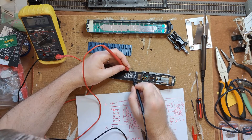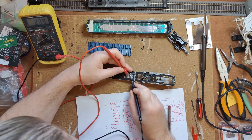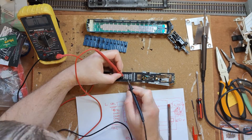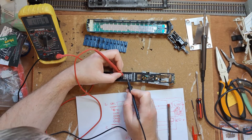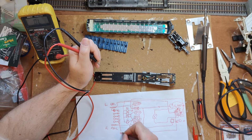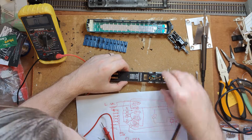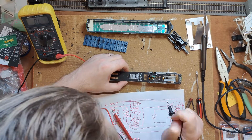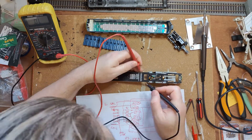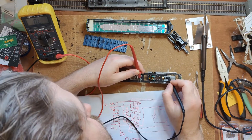The negative side of the interior light is much simpler. This was connected to both rails via diodes D5 and D6, so whichever was low would provide a current sink. This works absolutely fine in DC, but in DCC mode there's an unbalanced power draw through the decoder. Pin 7 is providing the power for the carriage lights, which is sourced from whichever rail is higher voltage at the time, but the negative side is not going back through the decoder at all. For basic DCC setups this is fine, but this unbalanced current draw does cause problems. Decoders have problems reliably detecting ABC when wired like this.